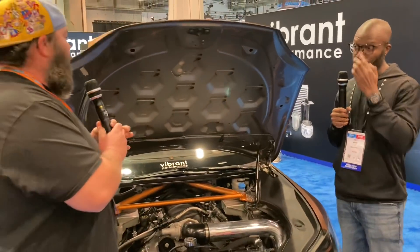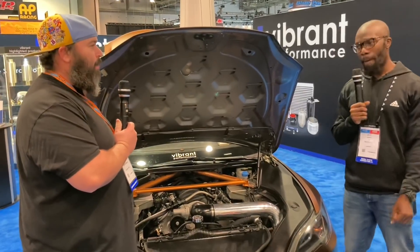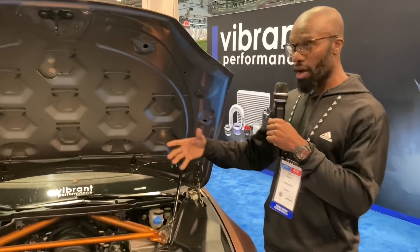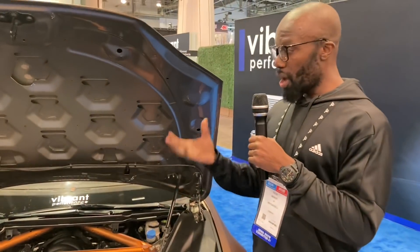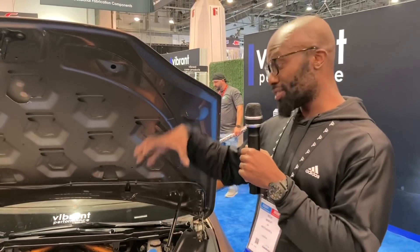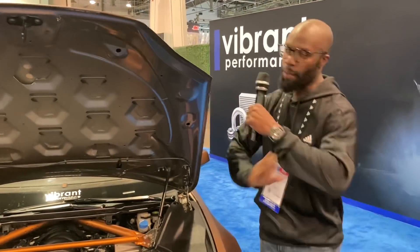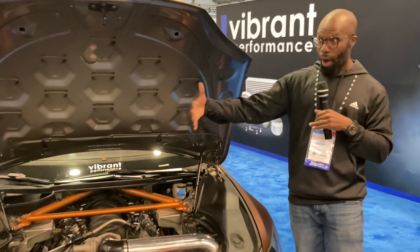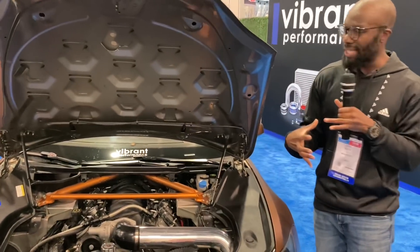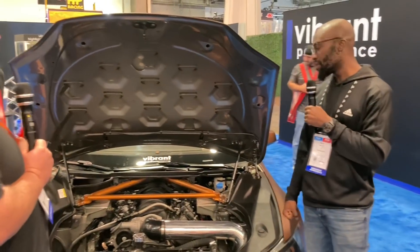After the transmission tunnel, we needed a rear end — originally this car doesn't have a typical transaxle. Through fabrication, we retrofitted the stock pumpkin — the rear diff out of a Camaro SS — to fit in the Tesla's stock subframe. It didn't need to be narrowed; it fit right in, because the Tesla stock motor is so wide and heavy compared to the diff. It's like the size of a pumpkin, but the diff is small and compact and fit right in the center.